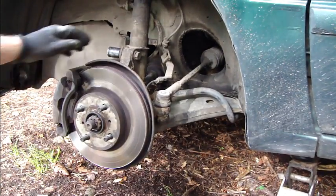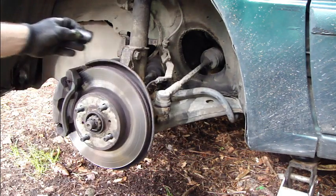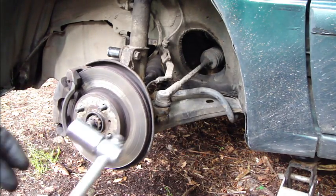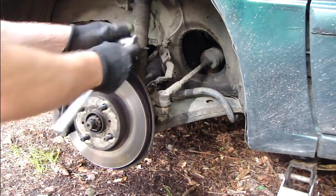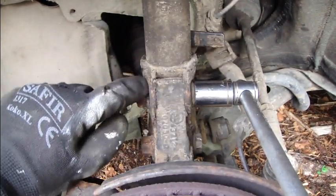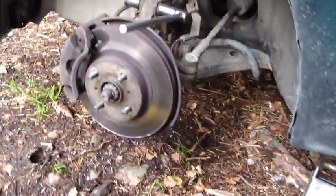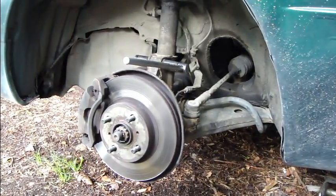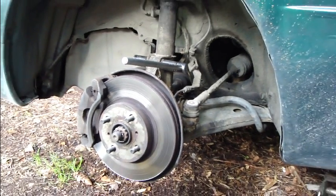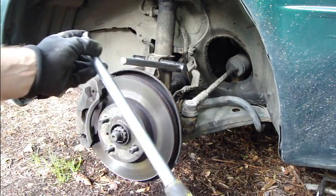Okay, and then when we start to open these bolts in here, you need a 19 millimeter socket, first in there, and then a second socket on that side, and because these bolts are very thick, this one and that one, when this is the nut that we open, you need a lot of force. And how can you get that? Of course, if you are really a bodybuilder, then maybe you have enough force, but normally you need a long wrench.